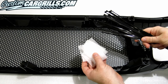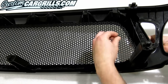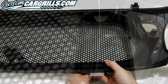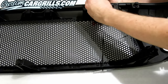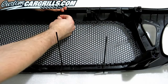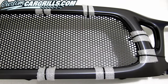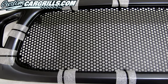Next, it's time to temporarily hold the mesh on with some soft foam and cable ties. To tie the mesh on, I'll start by looping the tie through the triangle side opening and through the mesh. It's important to have the head of the tie on the back of the mesh to tighten it to the back of the grill properly. Then repeat that step around the rest of the main center opening. Only a handful of ties are needed to hold this on, but there needs to be enough to firmly keep the whole mesh piece tight against the back of the opening. Additional ties in the lower corners may be needed. I'm then using some cutters to nip off the tails of the ties.